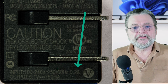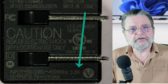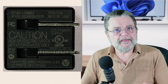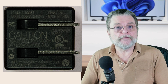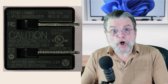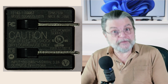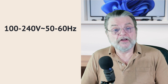The other thing you'll see is 0.2A. Honestly, you probably don't need to pay attention to that at all. All that means is that when your charger is plugged into the wall and actually charging, it will be pulling that much amperage from your wall socket. This input line is all about your wall socket — your mains power, as it's sometimes referred to. In this case, 100 to 240 volts means it'll work probably anywhere on the planet. 50 to 60 hertz means it'll work pretty much anywhere on the planet. The only thing you typically have to deal with are the different plug configurations.